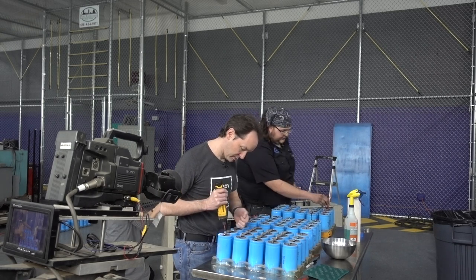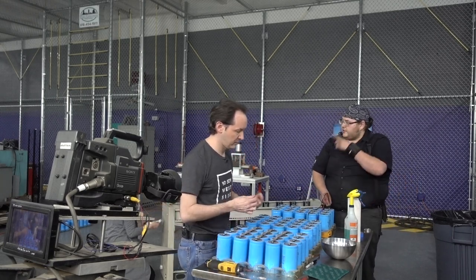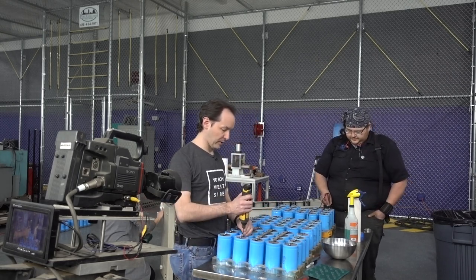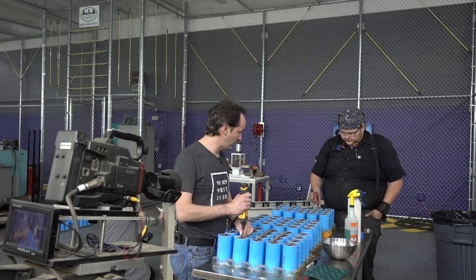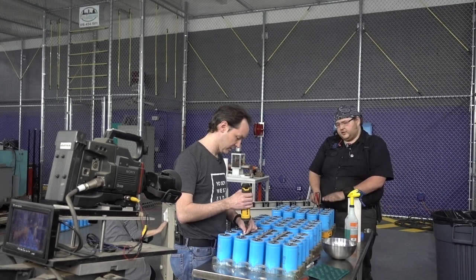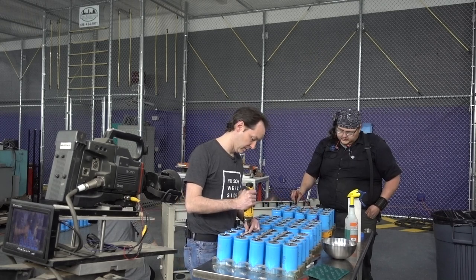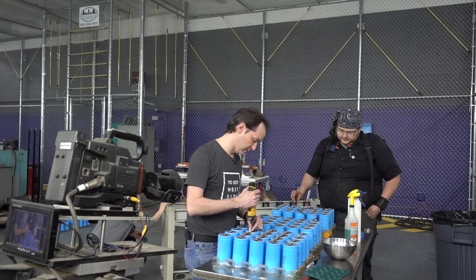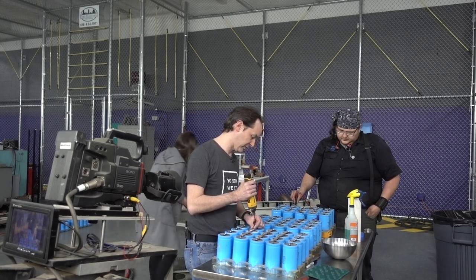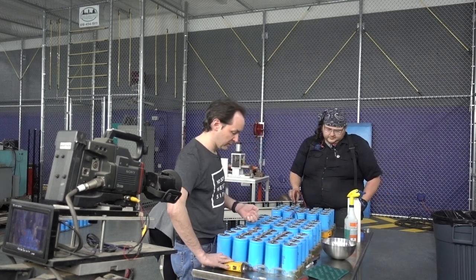So what I'm curious about though is potentially the copper bus not really necessarily being the best way to connect. Whereas like on Kicker we have just pieces of 10 gauge connected to it. The original setup for Thumper was wider. The bus was just more smooth. Right, but if you have like a cap that's sitting a little low or a little high, it's a potential strain. Well, we can do it with crimp connects and a whole lot of like 6 gauge wire. That's going to be fun.